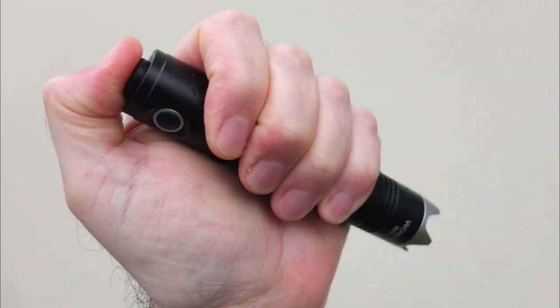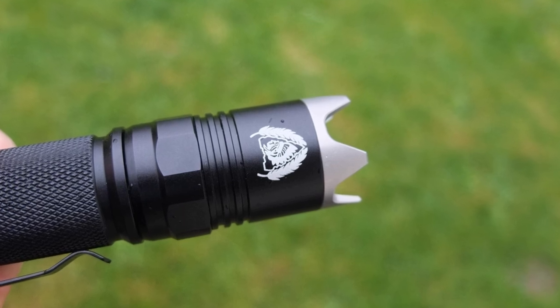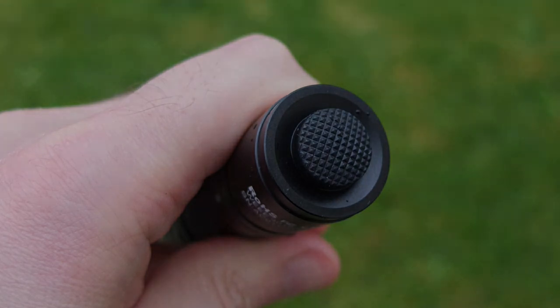It did work better than I was expecting, just not quite as good with gloves on. I would also like them to adjust the charging termination voltage, which is touching over the ideal 4.2V — that will reduce battery cycle life, so they need to look at that. Overall though, it is a nice torch and I think a lot of people are going to like this, particularly if you need this tactical design and easy strobe access. Thanks for watching, and I'll see you soon.